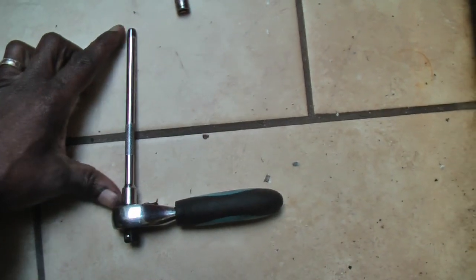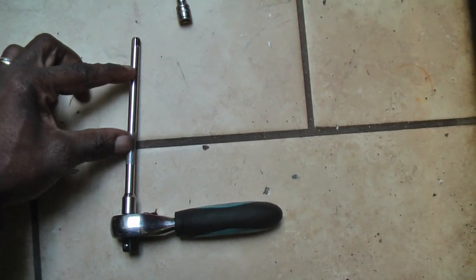Okay, just wanted to show you this. So this is the setup of how to take out those two awkward bolts of the housing. Now you've got your ratchet. I've got a 2-part extension, which is about 5 inches there, and probably a 4-inch bit with a little bendy mechanism and a 10mm on the end. That works for me. Let's go and have a look on the car.